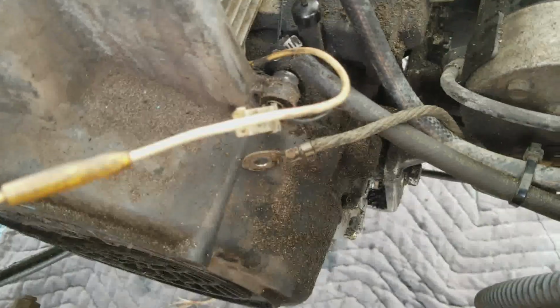On the bottom of that ignition coil was a ground wire. You can see it. That ground wire also attaches to the starter generator. We're going to remove that later, but I just wanted to point out that when we released the bottom bolt of the bracket that held the ignition coil, we also released the ground wire. I didn't label it yet, but I will.